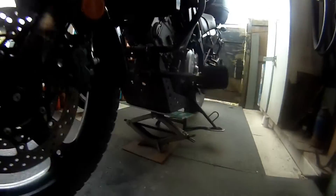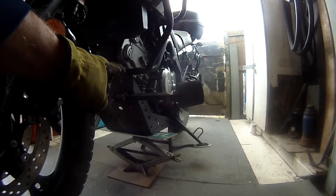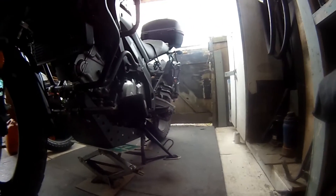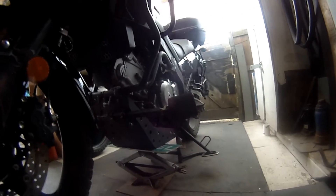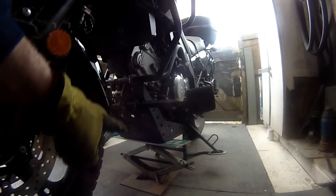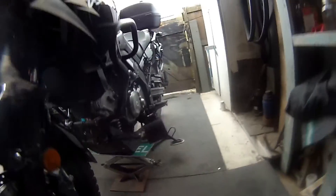What I've done is put a jack under there and lift it a little bit. I've got a center stand and that gives me that kind of clearance there. I can get even a little bit more — tires are very close. So in the case that you don't have a center stand, I've done it before with a block of wood or a block of rubber underneath the engine, but that's tricky. Often what I'll do then is come off the roof here with a couple of straps to the handlebars.